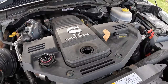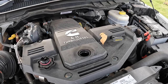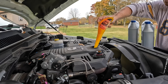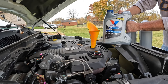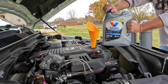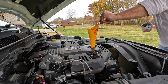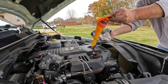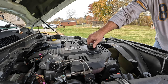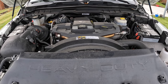Take the cap off and we're going to replace the oil. The 2017 Ram 2500 Cummins 6.7 diesel requires 12 quarts, so we're going to go ahead and dump the whole 12 quarts in. Got a little funnel here. Again, we have our Valvoline Premium Blue, Cummins Recommended, full synthetic. Let that drip a little bit. Looks pretty good. Replace the oil cap. Just got to start up the engine, let it run for five to ten minutes, let it circulate, and we'll give the oil a check.